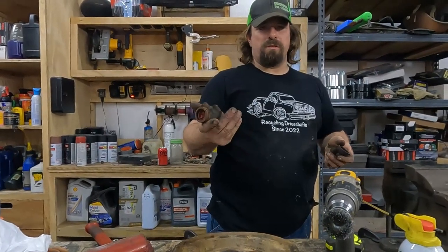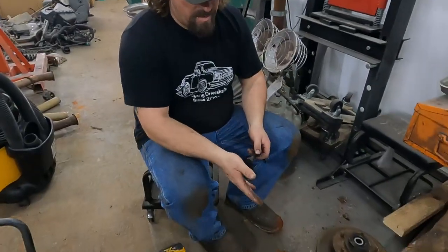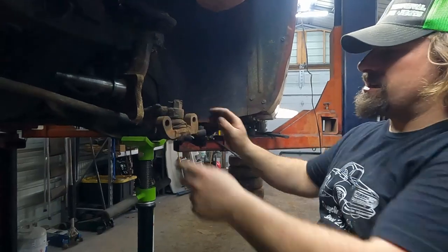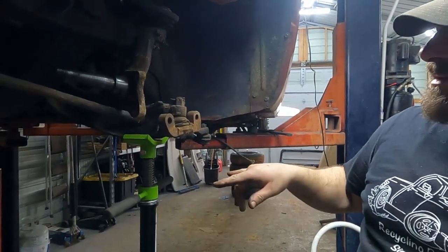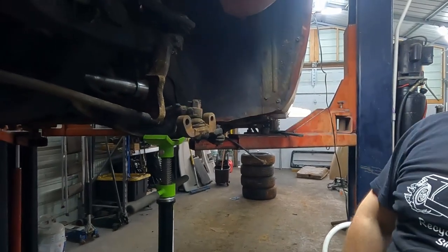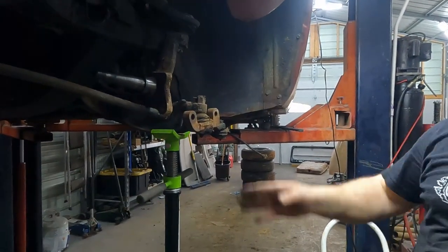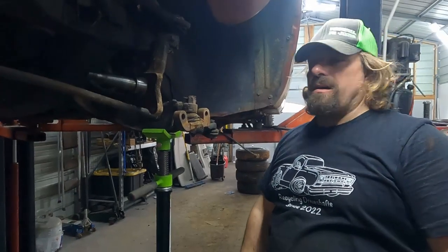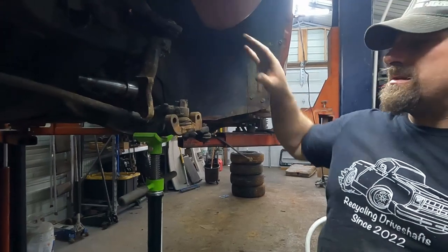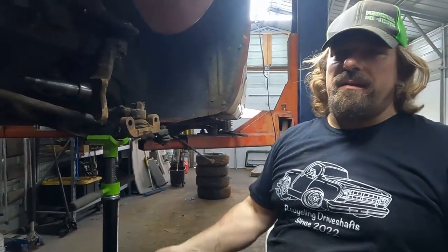So, new ones. Well, I've got this off and I've got that all tore apart. I'm gonna do some measuring and see if my plan to disc brake convert this car is gonna work. We're gonna try to set that disc brake spindle up here. I believe it's gonna bolt right in here and it's the same height, or real close to the same height and shape as this knuckle. And then we have a disc brake spindle. We just have to get longer brake lines, different rotors, new pads, and that's not gonna happen today.